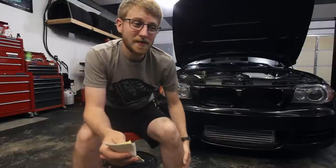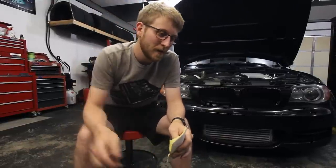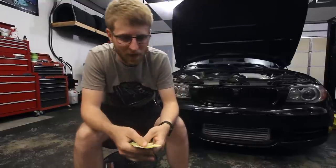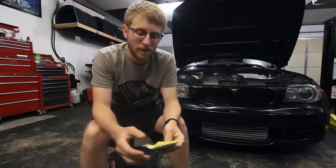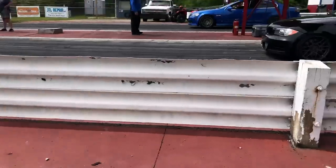So as you can see on this launch, I've lowered the RPM a little bit, tried leaving the hole again, but it burned through the tires, and I went to put it in second and it kind of bogged again, so I didn't make a full pass. It was still too much RPM for the prep. It couldn't handle it, and it just was boiling through the tire.